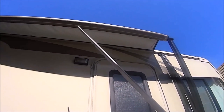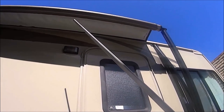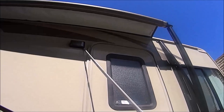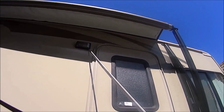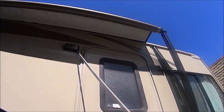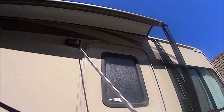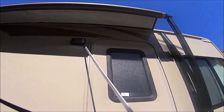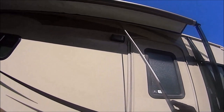Now remember I was showing you those little copper spots? Well, like I said, if you want to trim that light, you can solder on some more source lights. Well, you can also take a pair of scissors and cut off the wires that are connected to the end, and you can go ahead and source your power anywhere along that strip, any of those copper strips, and that's exactly what we're going to do. I'm going to source it right about here.